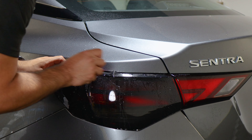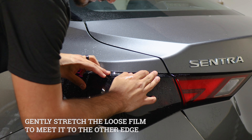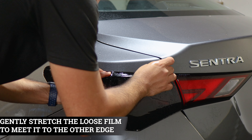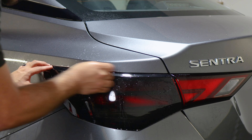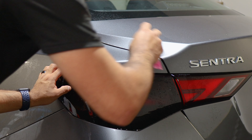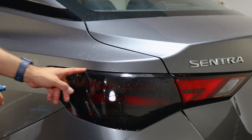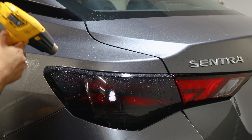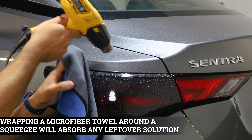Follow along with the rest of the film — just tack it down. Do a small stretch to reach the edge, making sure you keep it aligned as you stretch. To finish securing the film, apply tack solution and then apply heat on the top layer. With the microfiber towel, help tack down the film to secure it in position.